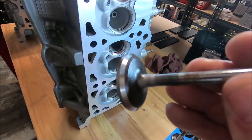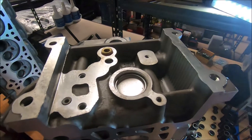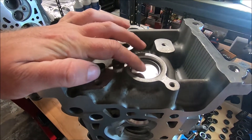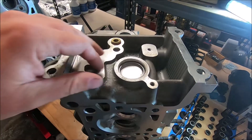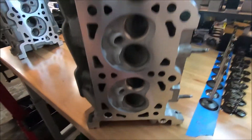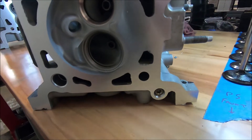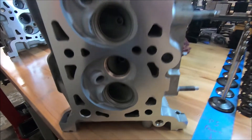Here are our freshly cut exhaust valves, cleaned up. One thing you want to check when these come back from the machine shop is make sure that any plugs that were in there when it went in have either been replaced or are still in there. Sometimes machine shops will pull these plugs out to clean inside and don't put them back in. I saw somebody assemble an engine where the machine shop had taken a plug out - there's one on both heads - and when they started the engine up it wouldn't build pressure and it would just come right out. So make sure all your plugs are in the right spot.